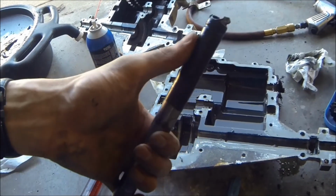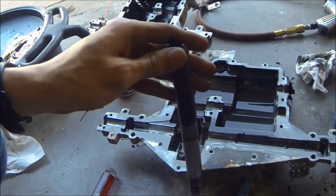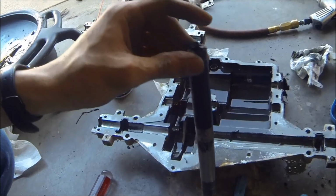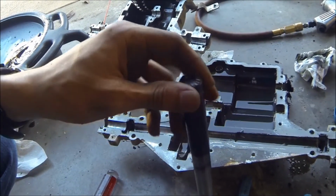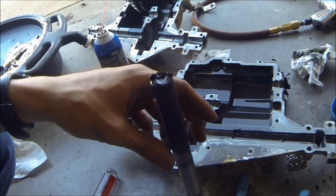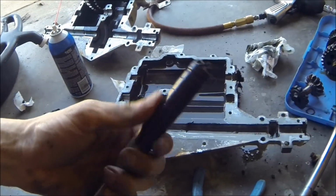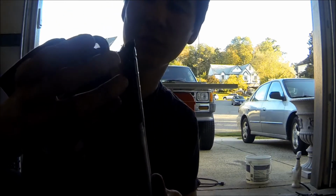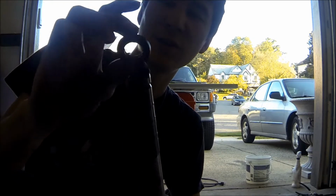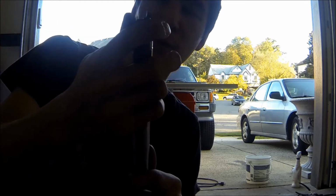So, you got your seals and whatever, and you got to slide it over the axle, and that axle's all rusty, and it's got that keyway in it, and it's got the ridge in it for the circlip, and you don't want to tear that seal because then it won't hold any oil and then your axle will leak out the wheels. So just wrap it up in some electrical tape like this, and then you can grab your seal. So we take our axle, smear a little grease, some oil on there, take our seal, which has just been cleaned and re-greased, and then slide it right over.